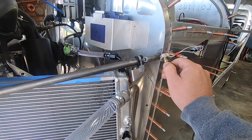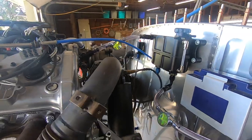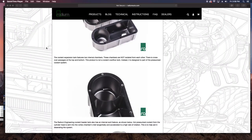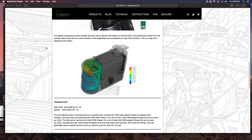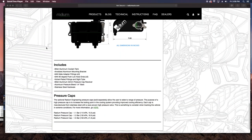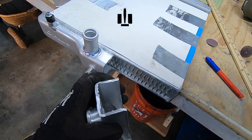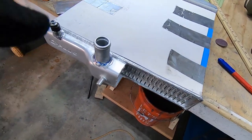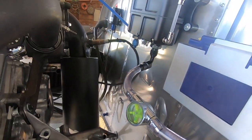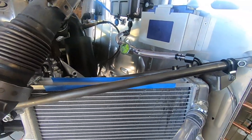I like to think out loud and give you my thought process as I go, so here's my take on what I've designed so far. I started by searching for a header tank that would fit my needs, and I found this one from Radium Engineering — it's a dual chamber designed to influence a swirl of the incoming fluid and aid in evacuating the air. With that in place, I found the largest radiator that would fit: an all-aluminum unit designed for a Honda Civic. I modified it, removing the pressure cap and flipping it over on its side. I have AN6 ports at the top of each end tank, allowing for an air path back to the header tank, giving me a self-bleeding system in the event that air finds its way in at some point.